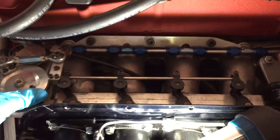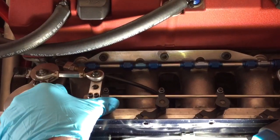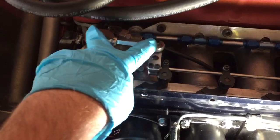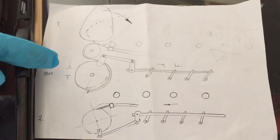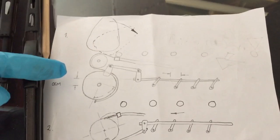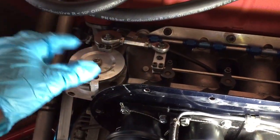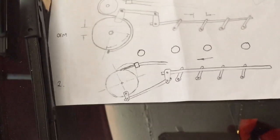We're going to have to change this whole system. It's a really quite complicated, lovely design. You can see the actuation there - I've got to measure the radial angle that this moves in relation to the almost linear movement of this rod here, and find a way of moving all of this out of the way, possibly mounting on the lower side. I've come up with a little sketch here with some ideas. One idea is to take this whole assembly plate that the throttle pulley sits on and twist it around like I tried to draw here, to gain clearance that way.